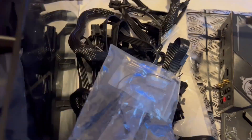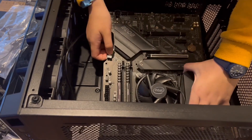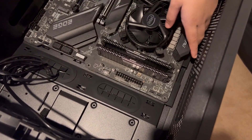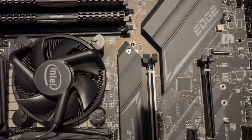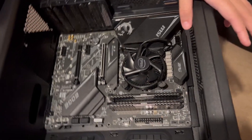That will go there, making sure this I/O panel goes into that socket. Lift it very carefully — make sure you align all the nine pins I showed you. They should seat properly by themselves. Let me check. The input-output panel is properly seated. That hole there is parallel — you've fitted it properly. Excellent! Now we need to screw the motherboard down.